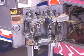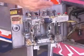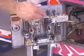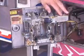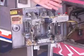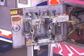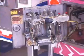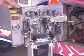A lot of solid state games also have options where you can actually set the game to be free play, so you never have to put any money through the coin door. And you would use like the diagnostic switches up here to set that option. Not every game has it, but most Williams solid state games do. Most Bally games before 1985 do not. Most Gottlieb games do not. And anything from the 90s generally will have some sort of free play option.